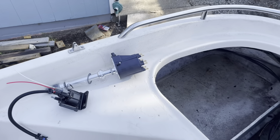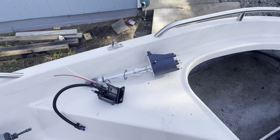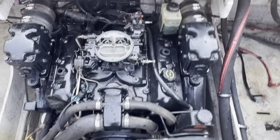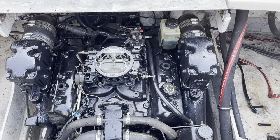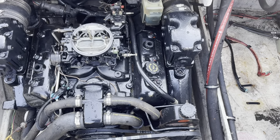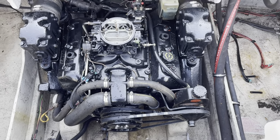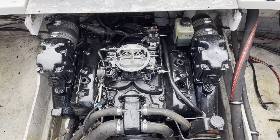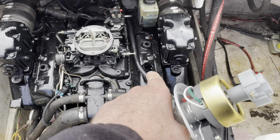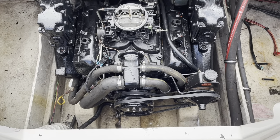At this time I'm going to put the distributor in without hooking up the wiring, then turn the motor over on the starter to build up oil pressure before connecting the ignition system. But first, I have to set this motor at top dead center on the number one cylinder so I can install the distributor with proper timing. I'll take the oil cap out, reach in and feel the rocker arm on number one cylinder as I rotate the engine to know whether I'm at TDC on number one or number four. The engine is now at top dead center on the compression stroke — I rotated the engine, felt the intake rocker arm move on number one, saw the timing mark just past TDC, rotated another 360 degrees, and now it's at TDC on the compression stroke.